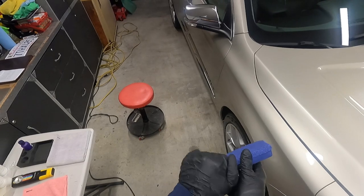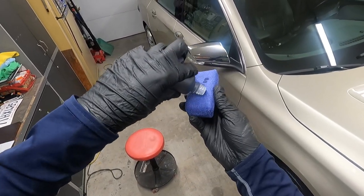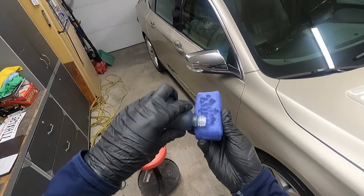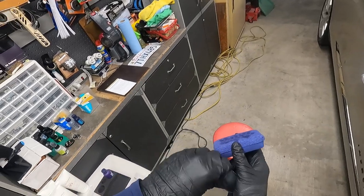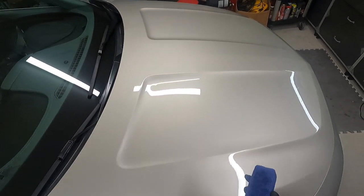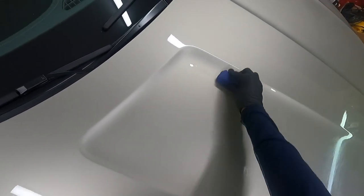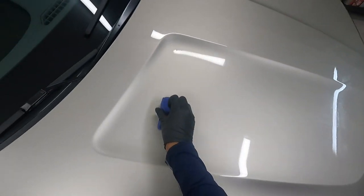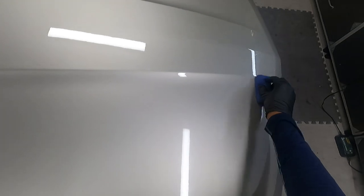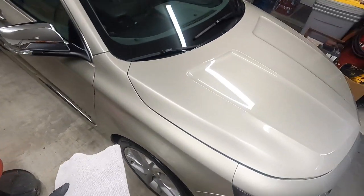Shake up your bottle. This goes quite a long way, so I'm just loading up the applicator to begin — with the microfiber side. It will spread a lot further once it's primed. I'll work a small section here just to give you an idea of what it's like. I'm just going to do two passes. You can already see it starting to do that sweating effect. I'm hoping it picks up on camera — you can see these little beads on here. At that point it's already ready to be wiped off.